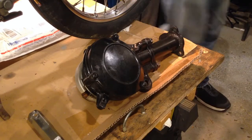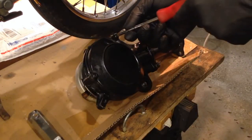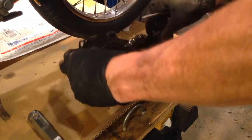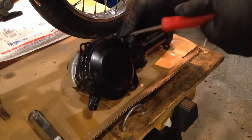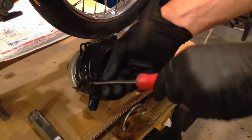On my Phillips screwdriver — I thought I just had it out here. So basically, to get the ring gear out, there's just these three Phillips screws, or sometimes they're bolts. I think maybe someone had replaced them with bolts in the past.